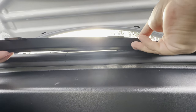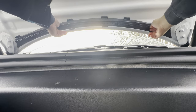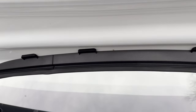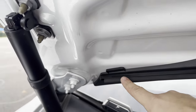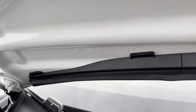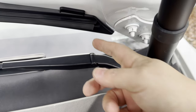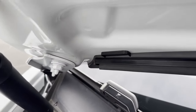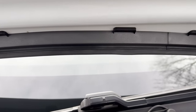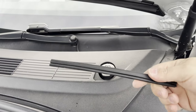The pieces don't snap together — they just fit loosely. I did have a hard time getting them up and holding in place; they fell a few times before I could get them to snap in. My tip is to make sure you press and get each piece snapped in before moving to the next section. Start from the driver's side and work your way out. Once the deflector is affixed, slide in the rubber seal — it can only be inserted from the driver's side, and it may help to wet it or apply a lubricant like WD-40.